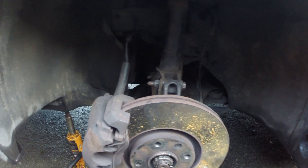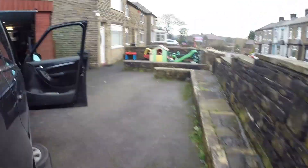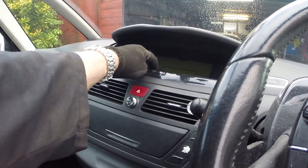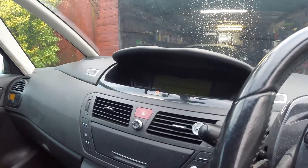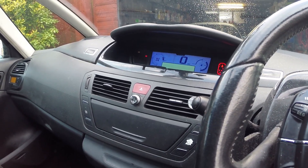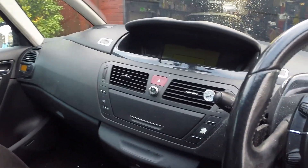I'll just finish buttoning this up and then we'll move on to the handbrake cables. I've got the wheels off both sides and we're up on axle stands, which is safe. I'll just give the front wheels a quick test — that's not good anyway, so we're safe. Now I'll show you how to release the parking brake: put your foot on the foot brake, hold that down until you hear that sound, then turn on the ignition with your foot on the brake, and that's the handbrake released. You can turn the ignition off and it won't re-engage the handbrake. That's how you release the handbrake on these.